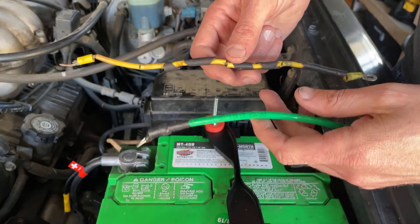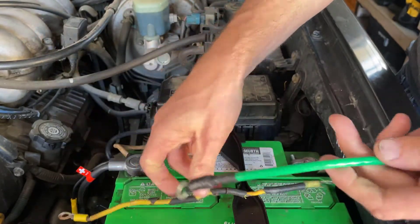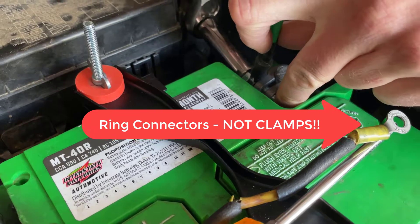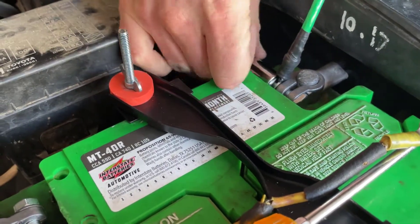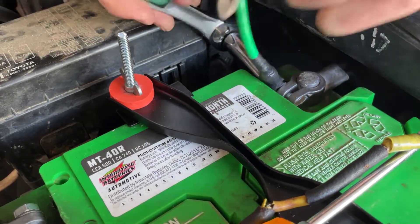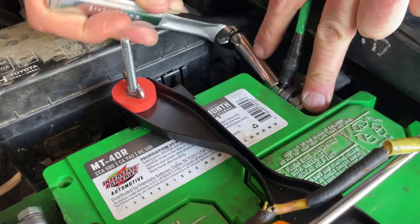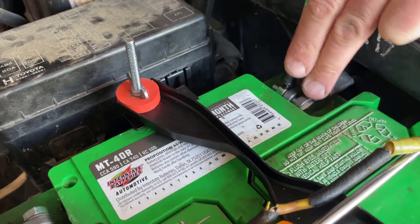The final portion of this installation is a secondary ground wire. The old one on top is pretty old, nasty, cracked, and frayed. The new one I put together is just 10-gauge ground wire with two automotive clamps. Here I'm installing it on the negative terminal of the battery — it serves as a secondary ground wire, so we're putting it on the ground side. This area was tight so it took a little while to get it completely cranked into place.